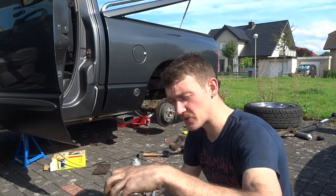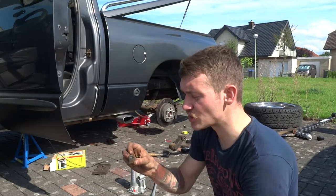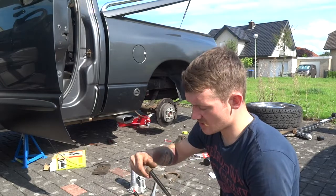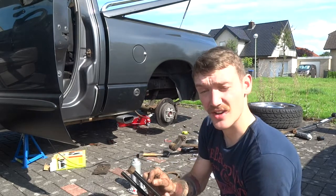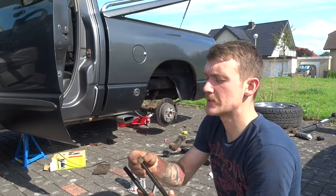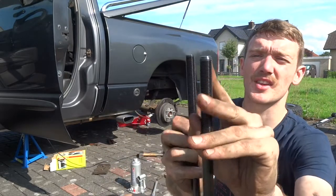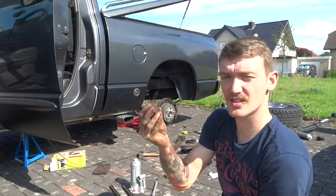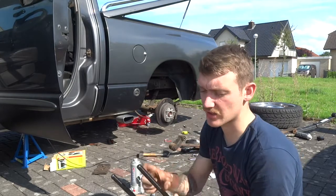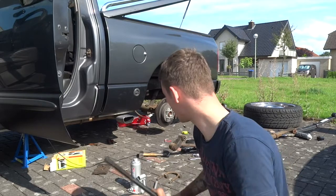If you want to do it properly, you'll angle grind them, round them off, and back the nut off. Use the old nut to do this — not the new nut — because you don't want to wear out the nylon locking device inside the new one. Thread the old nut on until it's nice and tight, put the angle grinder at a safe, sensible distance leaving a good five to ten threads remaining. Then use that same angle grinder to round off the end the way it was from factory. Back the old nut off — that will clean up the thread — then put the new nut on and torque it to spec, using a deep socket.